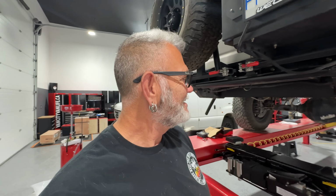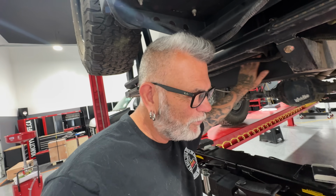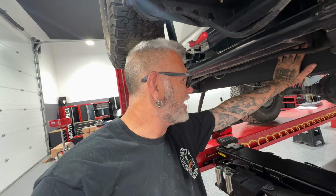On regular pavement, sure, you get better fuel mileage. But when you air down those tires to reduce the puncture rate, because when you drive the Dempster Highway or gravel roads at full tire pressure, there's a very high chance you could puncture your tire. So you drive at a little bit lower tire pressure, so that anything sharp that hits your tire gets absorbed in it. But it also crushes your gas mileage. So having the external fuel tanks means more days out in the backcountry.